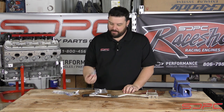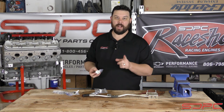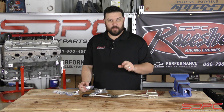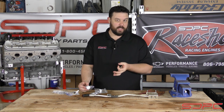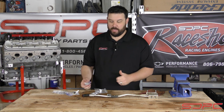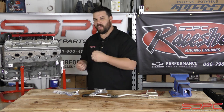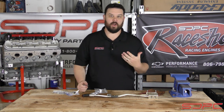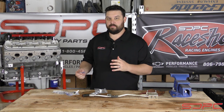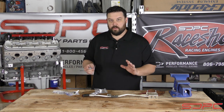Most of you don't have a 17mm Allen hex in your toolbox — I don't either, I can't find mine right now. But what I've done: you take a 10mm bolt whose head is 17mm, add a couple of washers, and I actually tack-welded mine together so I could use it both on and off. It makes a great stand for a socket wrench or box-end wrench. And that is all you need to know to delete an oil cooler on your LS or LT engine swap.